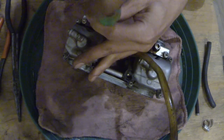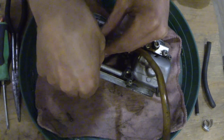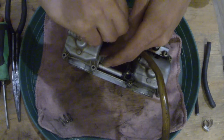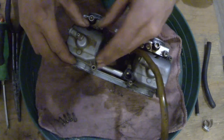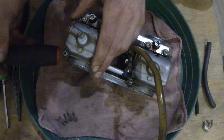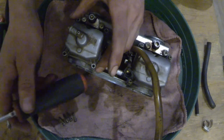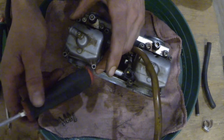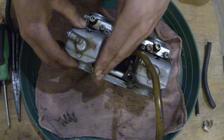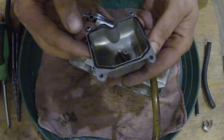I'm really hoping this looks really clean. It smells like some pretty old gas. I'm not expecting the greatest outcome, I'm hoping for the best. It's stuck on there a little bit — if I remember right, this is a rubber gasket. I'm just going to tap very lightly with the screwdriver on the corner edge. Very lightly, just try to break things loose a little bit. I don't want to rip any gaskets, I don't want to break any aluminum pieces. And she's coming apart. Did good.